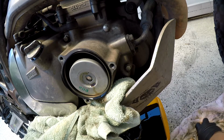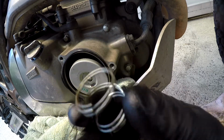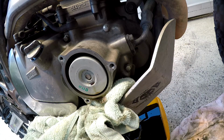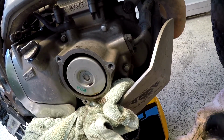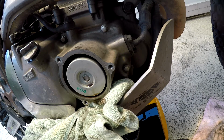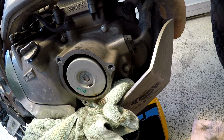When you take the bolts out, this thing should drop out. It should have a spring pushing against the filter and an O-ring that goes against the surface and into the groove there. Just gonna pop the O-ring back on and clean out the filter cap with some towel. Doesn't need to be awfully clean, just make sure there aren't any chips under.